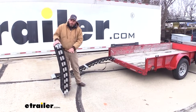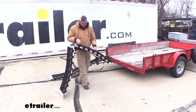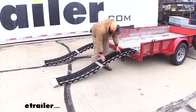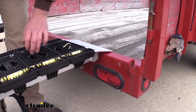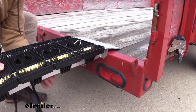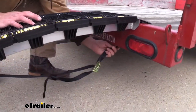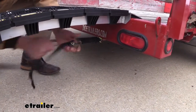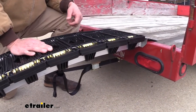To get our ramp set, we'll want the arch and the ramp facing our truck or trailer, then we'll just need to extend it out. You'll notice as we get fully extended, the lights come on. We've got our nice long aluminum lip here — we want to butt this right up against our trailer to prevent any sliding forward. Then we've got our safety strap here, which we want to hook in underneath our truck or trailer and pull it to cinch. That's going to prevent our ramp from sliding rearward and causing us issues.